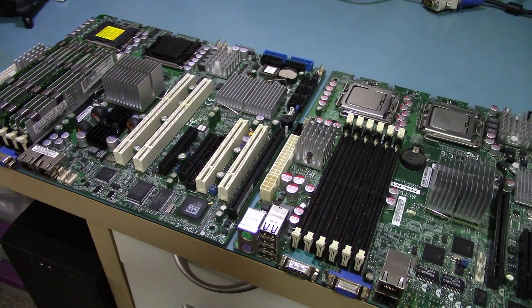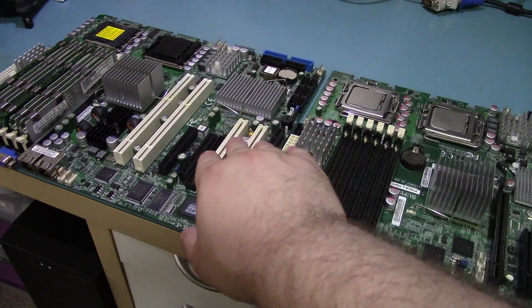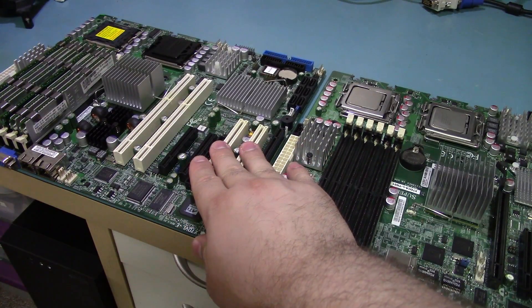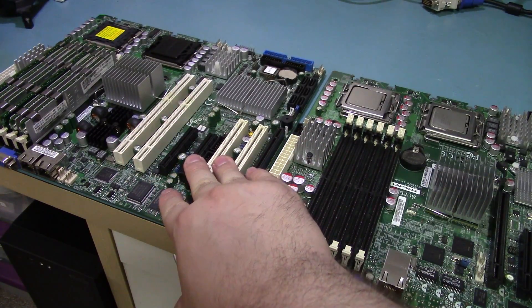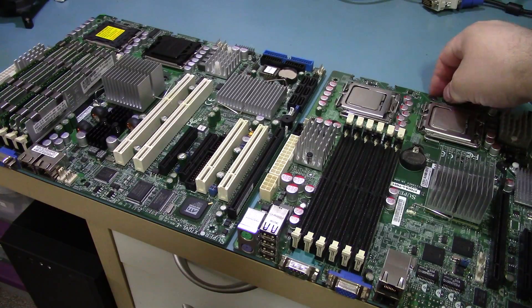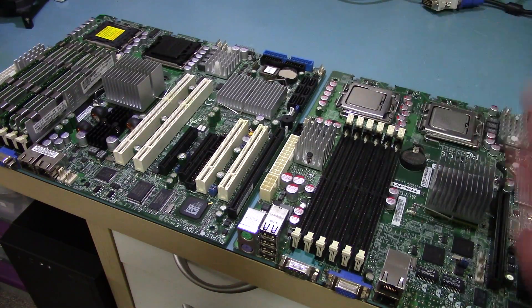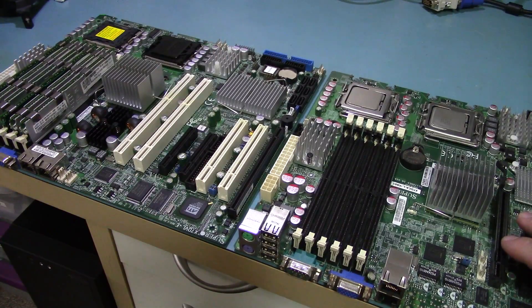This one's going to require a mod to my case. It's a cheap case — the Corsair 100R, which is like $20 after rebate — so I don't mind Dremeling some metal off it. Unfortunately, this one didn't come with a back plate, so I don't know if I'm going to bother. It may be worth tracking one down, because the heat sinks don't screw into anything — they just sit there and are supposed to screw into the bottom plate or chassis. I may have to get another back plate if I can find one for a few bucks.